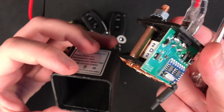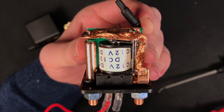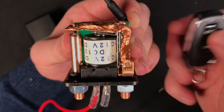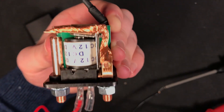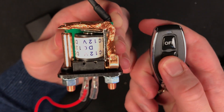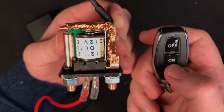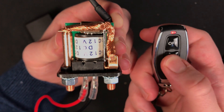Let's take a look inside, shall we? On the inside, you can see a 12 volt solenoid switch with two big copper wires leading up to the contact plate. I'm actually surprised by their thickness, as I expected them to be smaller. The switch is actuated by sending a small current through the magnet and responds to a wireless transmitter that I can attach to my keychain. I first thought about installing a manual switch, but this is much easier.